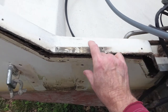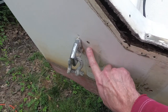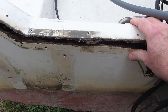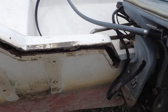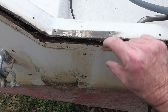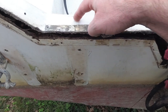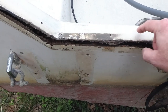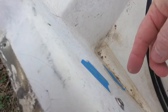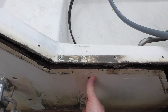I took off this section on both sides. Here's where the kicker motor was, and here are the old bolts for the kicker motor. Because this transom is a little bit squishy, I'm concerned, but I'm not going to replace the whole transom. The way I want to approach this is I'm going to put my new bracket on — two inches by two inches — so it'll go down about where the old one was and farther over up here. I want to seal this, and in this area I'm going to put these bolts back through and put sealer on, and that'll help hold this tight.